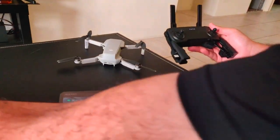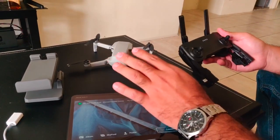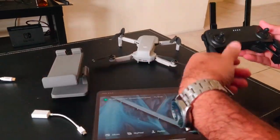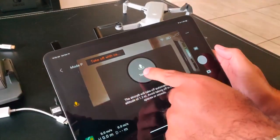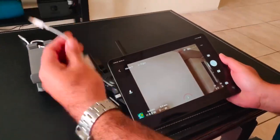DJI tells you that if you are going to use the tablet holder, you must buy this adapter extension. But the idea is to find out if you already have a long cable that connects from the drone controller to the tablet, whether you really need to buy this or not. Unfortunately I don't have a long cable, so I connected it directly to see if it can reach the tablet. And yes, it works. You don't need to buy this adapter — you just need a longer cable. You can use whatever cable you want to connect the tablet directly to the controller, with the condition that it must be an OTG cable. OTG stands for On The Go, which means you can transmit data from the tablet to the controller, and the tablet will work as a host. If the cable you connect is not OTG, it won't work.